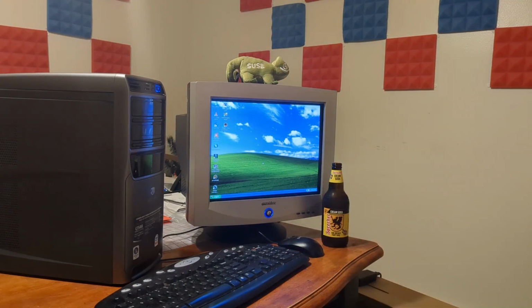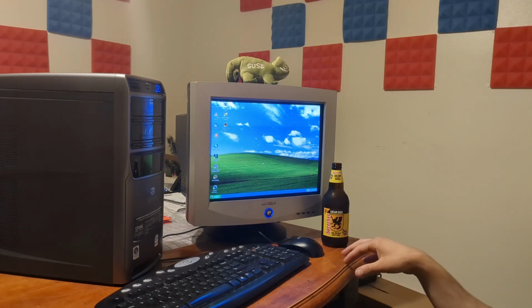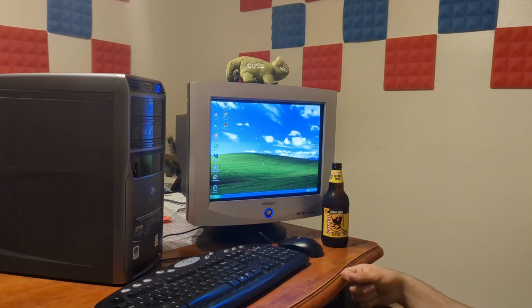There you have it. This thing fought me every step of the way. I have multiple hours of outtakes of RAM issues, XP crashing every time I tried to install it, which, by the way, turned out to be AHCI on the hard drive. I turned it off at one point, but I guess there was some weird hiccup, because the next time I fired up the computer, it said the CMOS checksum had failed, and it didn't save the settings, which meant AHCI was still on, and I didn't catch that, so I spent the next 2 hours trying to figure out why XP wouldn't install.